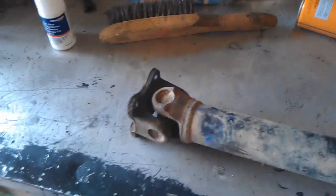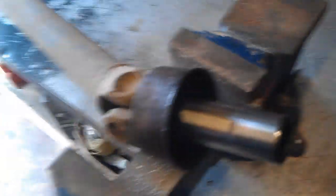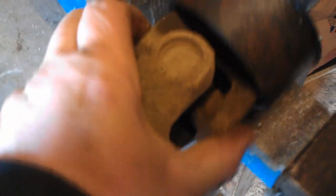After a bit of effort I couldn't get to the top bolt, so I had to mess around for a bit. You basically knock that down off the flange it bolts up to and it pulls out. It turns out on a Pajero you do lose quite a lot of oil out of the transfer box. This end isn't too bad but this end is just completely disintegrated — basically completely and utterly gone.